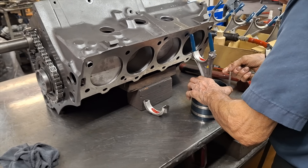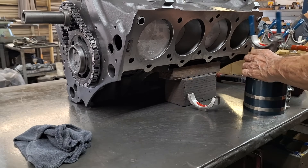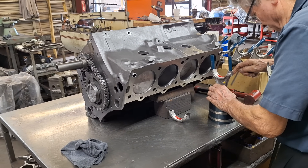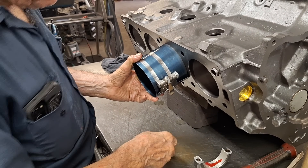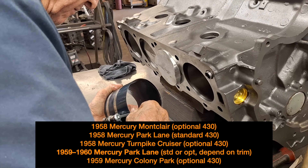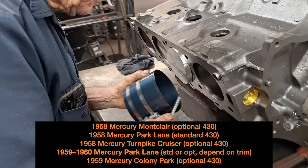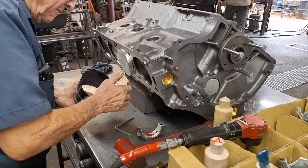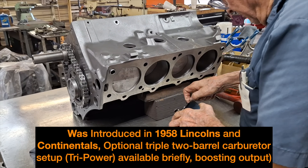This is an older style ring compressor — it's what they used to use all the time. They work really well on these blocks that have that scallop in them where the chamber is built into the block. This helps get that edge. This is the specific ring compressor — very special. This is an older style compared to the ones we usually use. Nothing's ever easy with these antique ones; you always got to fiddle with something to get them put together.